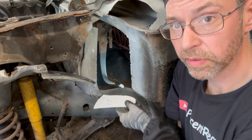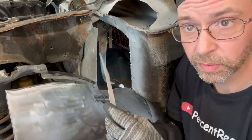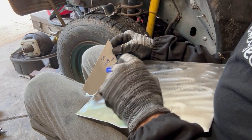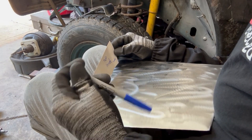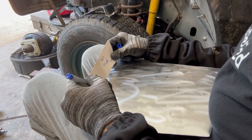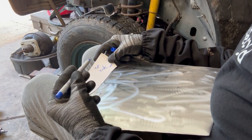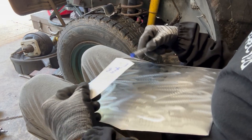I made this little template - it basically follows the curvature of this bend. I'm going to use it to mark out on this piece to hopefully follow the bends so I can bend it more smoothly in my press brake. It's still going to have to be a little tweaky but this should help a huge amount. The bend is going to start in this area and go about to here, and then fold back the other direction. This upper area is going to have a much gentler bend if not at all. I'm marking out little arrows to remind me where I'm trying to bend heavy or light, and I might have to reverse the part in the brake and bring it the other way.